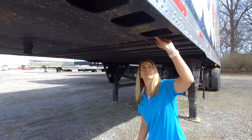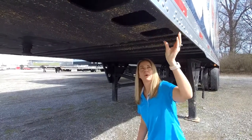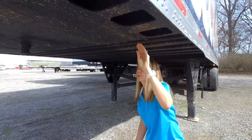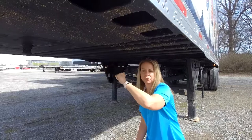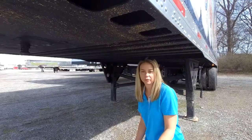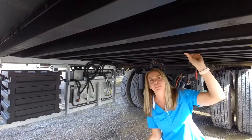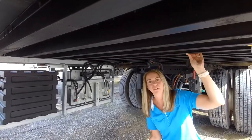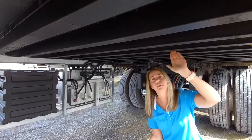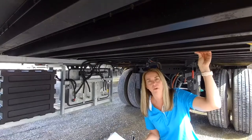On our heavy-duty model, this approach plate right here is a 5/16-inch approach plate. What that does is provide thicker material up here to prevent the dishing effect after years of abuse with that truck hooking up and releasing from the trailer. One of the greatest features on our heavy-duty beverage trailer is 8-inch crossmember spacing full length of the trailer. The standard trailer comes on 12-inch center lines for your crossmembers, whereas these are 8-inch crossmember spacing full length on all of our heavy-duty models.